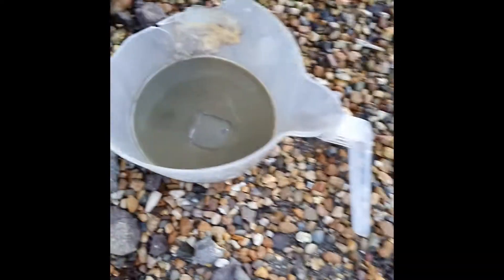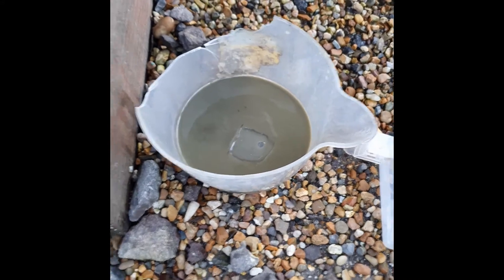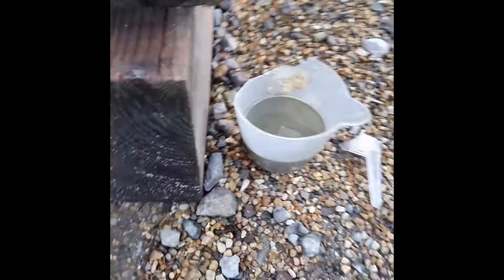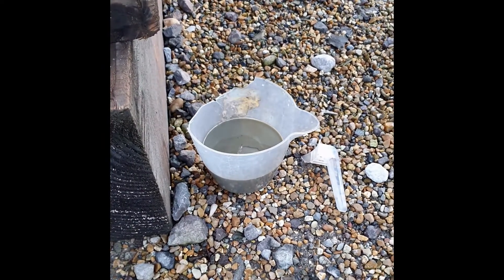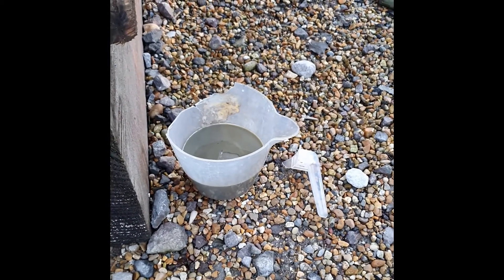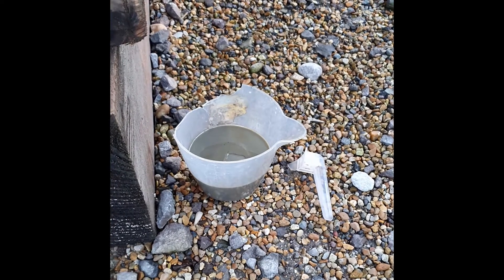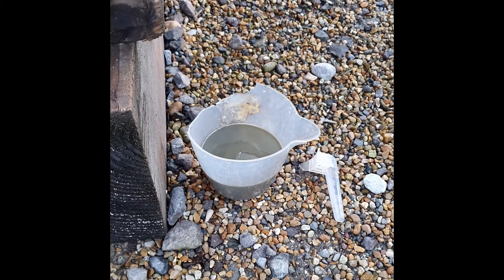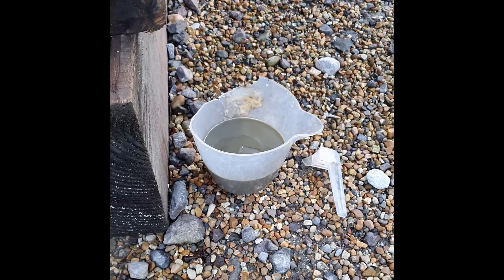One thing you can see is from when I drained the gearbox there's a bit of milkiness to the oil. Having checked it over, there's nothing wrong with the gearbox and it also runs fine. A quick consultation with American Imports came to the same conclusion: all that needs to be done is ensuring that the drive shaft seals are replaced — two which sit underneath the water pump back to back, and two on the drive shaft itself. I'm not going to replace the oil now; I'll wait for those parts to arrive.